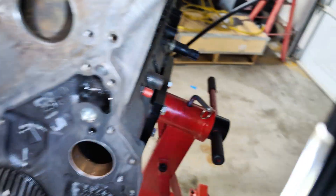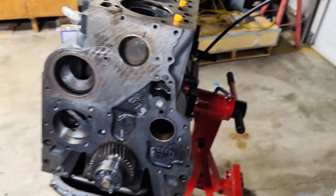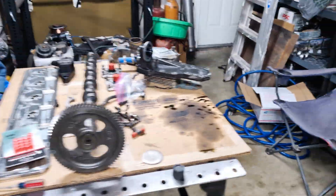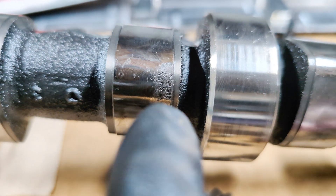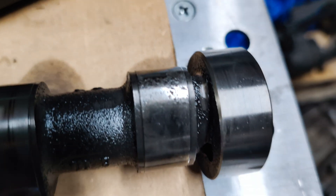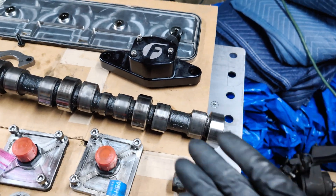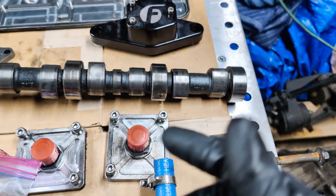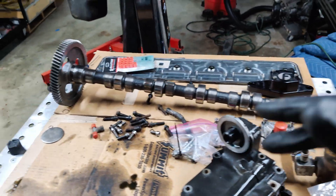Going to the front of the engine, pretty simple. You just have one bearing for the cam and that looks great, so I'm not going to be changing that. But when I took apart this engine, I did have one concern, and that concern was on the camshaft. You can actually see on this lobe, you can see the pitting there. This lobe — it's definitely lighter pitting, but it's all throughout the whole crown. I also have lobes that look even worse. If I run my fingernail over this, none of it's raised up. And none of the bearing surfaces have any pitting.